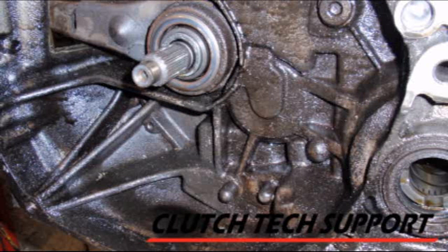The oil in this transmission housing was not coming from a leaking rear main. It was coming from a worn-out O-ring on the distributor just above the transmission housing, and it dripped down in and contaminated the clutch.